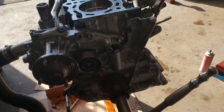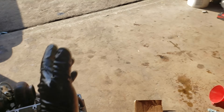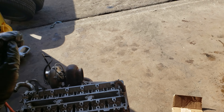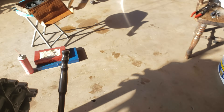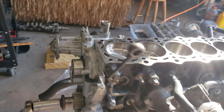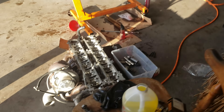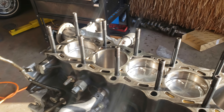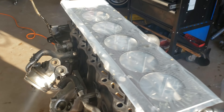Look how beautifully they move in harmony together — awesome. Now I'm going to start working on the head. I'll clean it up real nice, put the head gasket on, drop everything in there. I just put the ARP head studs in and I'm about to put the head gasket on now, then put the head on.